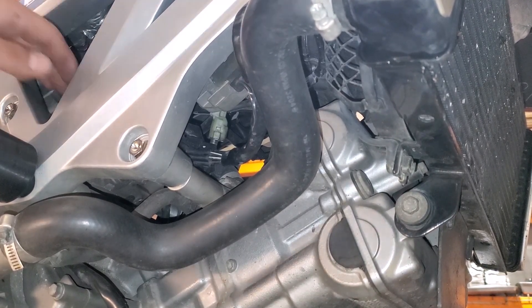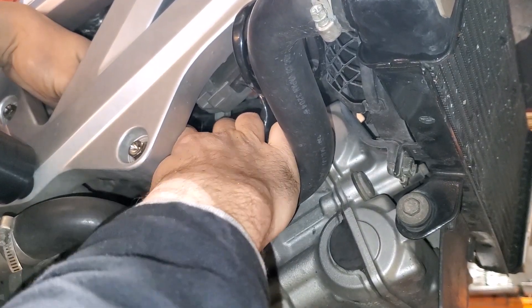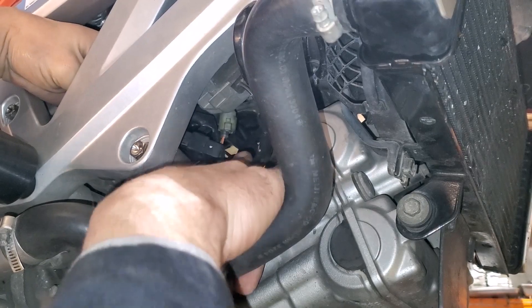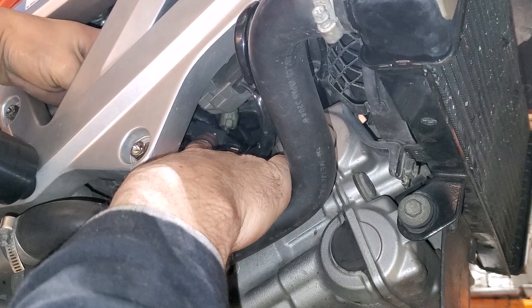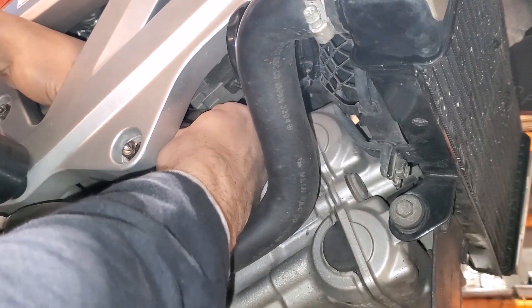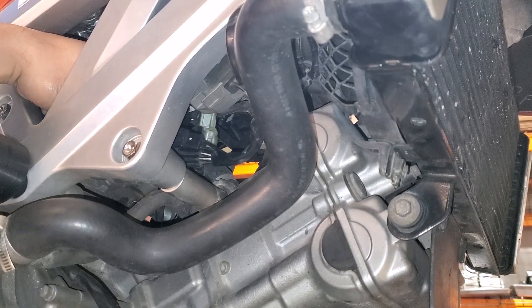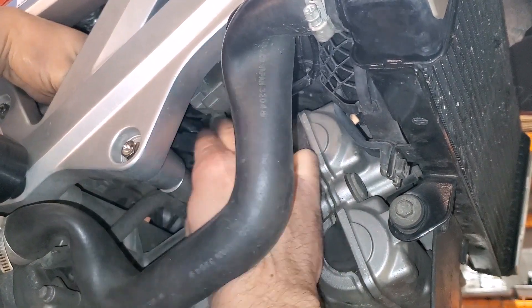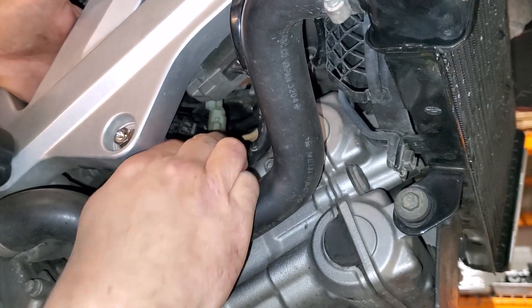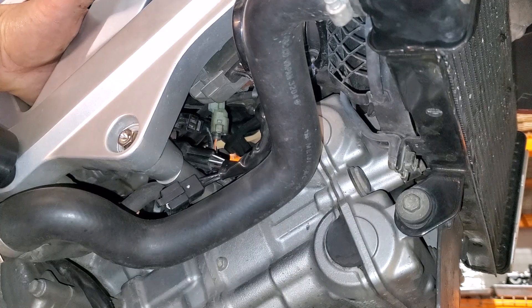For those that enjoy watching me suffer, here's what unplugging it is going to look like — basically trying to get my hand in there and squeeze down the one pin on the connector. One trick for getting connectors apart when they're stubborn is to push them back together first. Alright, maximum masochism achieved. Here is the three-prong connector, the same connector that comes off the stator.